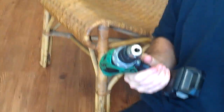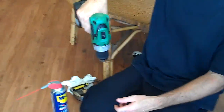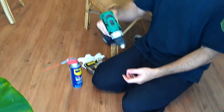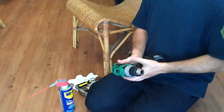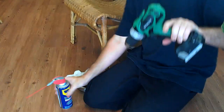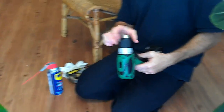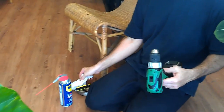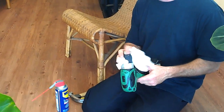The bit fell out. Once the bit falls out, you're good. Then what you want to do is soak with WD-40, flush it all out — go through this whole process of getting all that rust, junk, sand, or whatever's in there out. I was turning it upside down, flushing it out until it was running really clean, and then I cleaned it up with a paper towel. It's still kind of leaking WD-40, but it's definitely working better now.